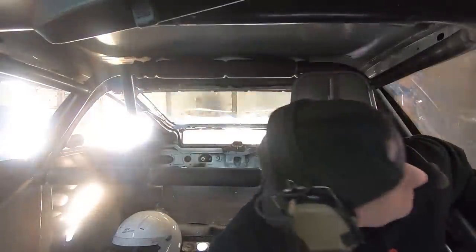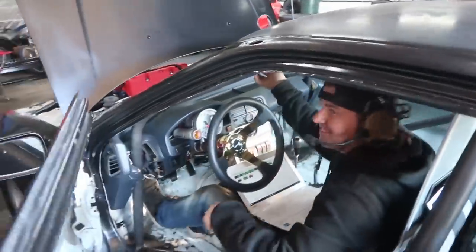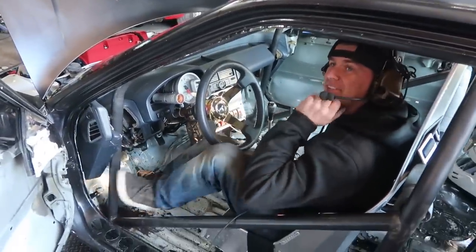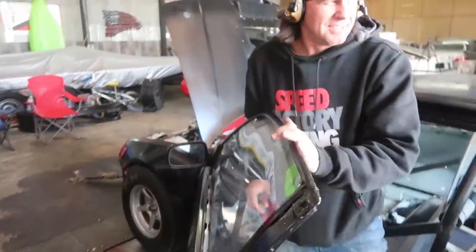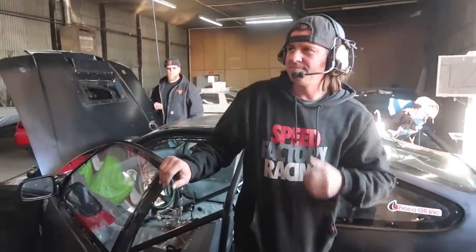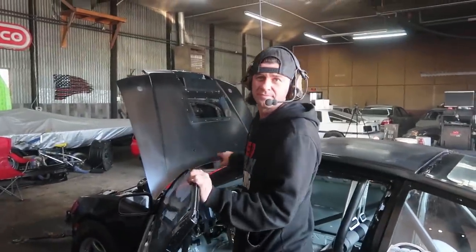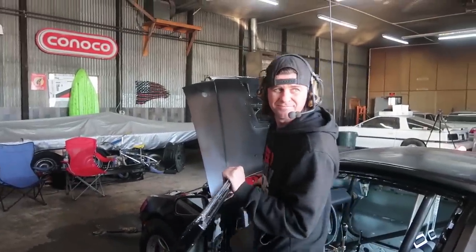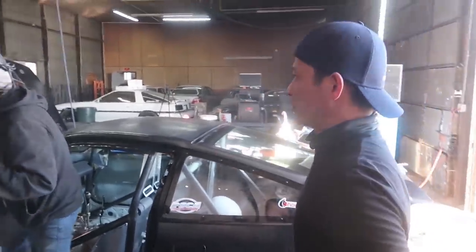On the right track. 321. Not bad. Definitely in the right direction. Once they're degreed, they're gonna be better. So maybe we'll just run in this direction and I still gotta add a little fuel to it. Just tune it is what it is and then we worry about it later. But the fact that it's wanting more fuel means we're on the right track, because this cam is more fat than the other one.